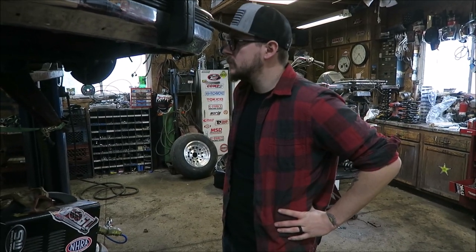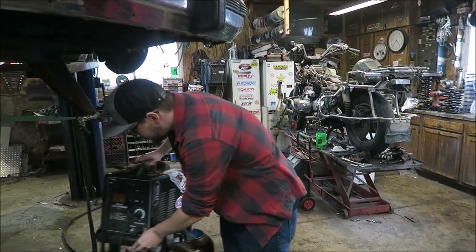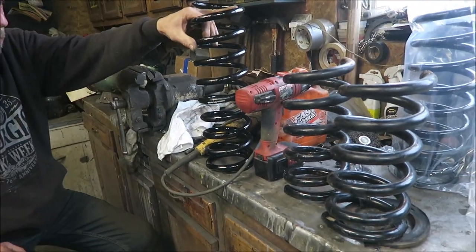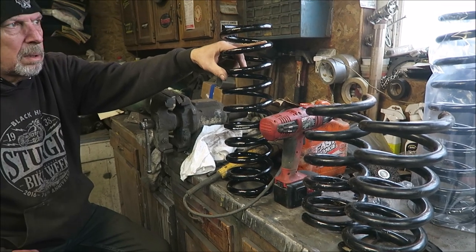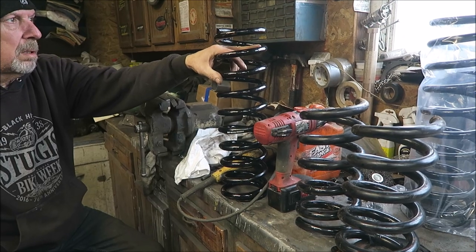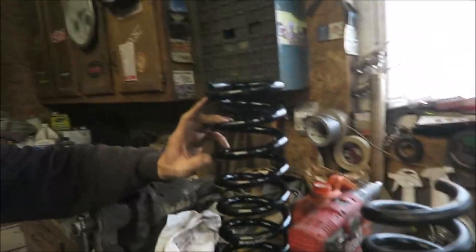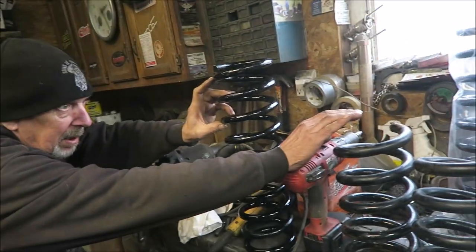Our plan from here is to mess with the new springs and hope it's good. We're thinking we cut them about as high as we can just to see how much they'll drop with weight on them, and then we can use that to estimate. It looks like it only takes about an inch out of it, and the others are about here — stiff as hell, they're a hair high.